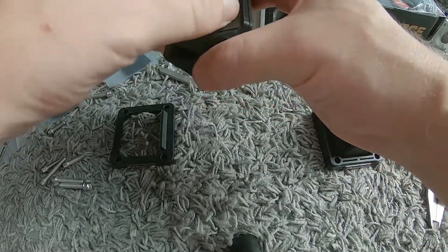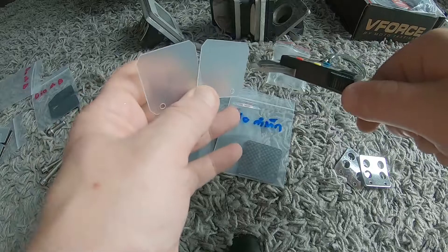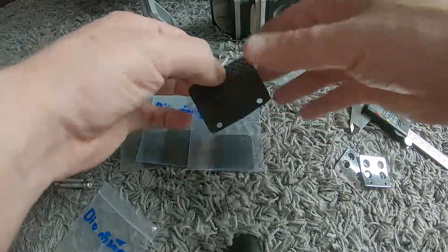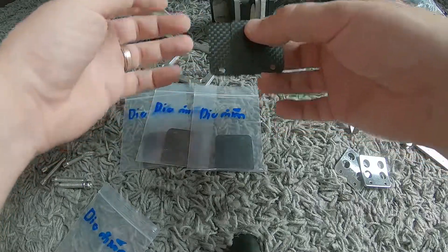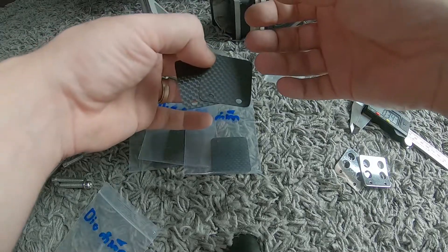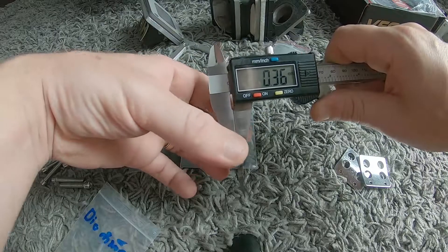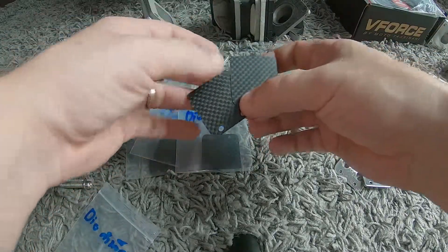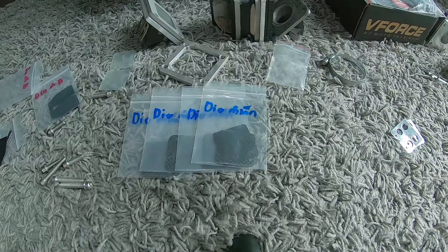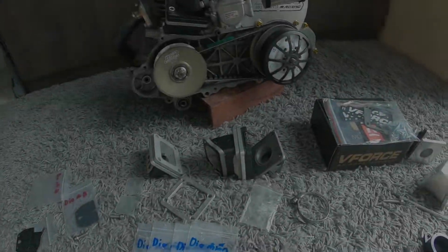There's one more thing I wanted to show you. These are the original reeds for the regular TWH manifold — let's check them: 0.36 millimeters, which is pretty thick. Now these are made by the same guy — I had some RGS GSO carbon fiber reeds for the regular TWH manifold, gave him those dimensions, and they came out a bit thin at 0.3 millimeters. So I asked him to go a little thicker, and what we have here is 0.36 millimeters. These are also a nice way to upgrade your regular size black manifold. All these small things help towards making your racing project work to a hundred percent of its potential.